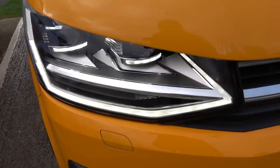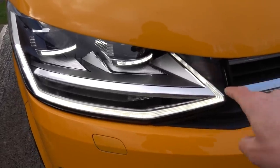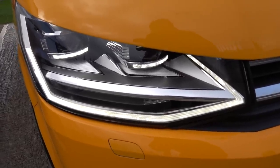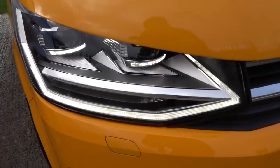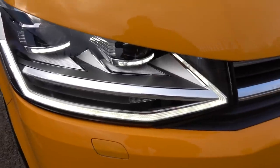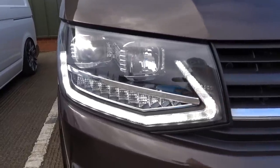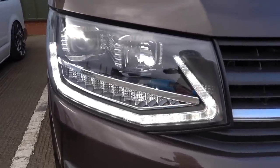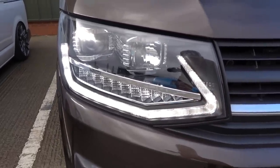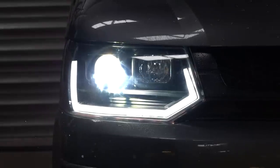Why can you see the dots in the DRL on our headlights? This genuine T6 headlight also has the dots because the LEDs are individual. The LED strip tape you can buy off Amazon and eBay just isn't up to the job - it doesn't have the life that individual LEDs do, so they have to be individual LED dots, just like on the genuine light. The way around this is to change the crystal-coloured diffuser to a white finish, which is what we've done on the version three lights.